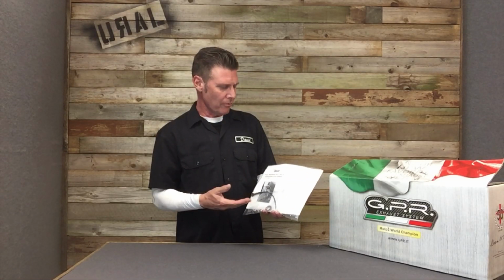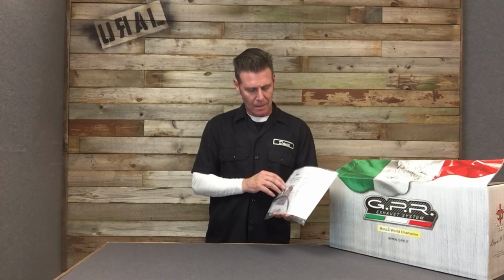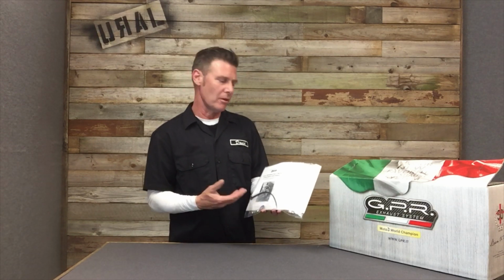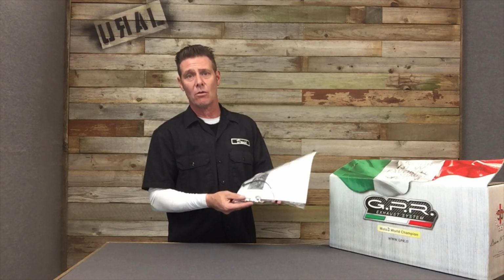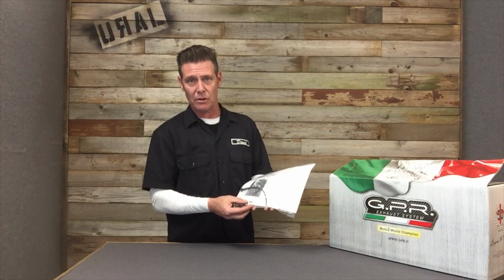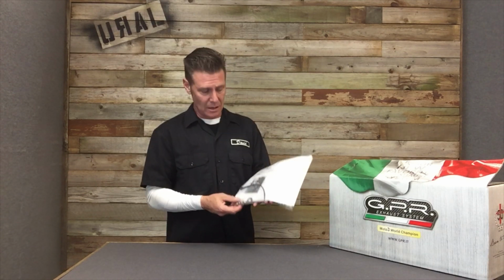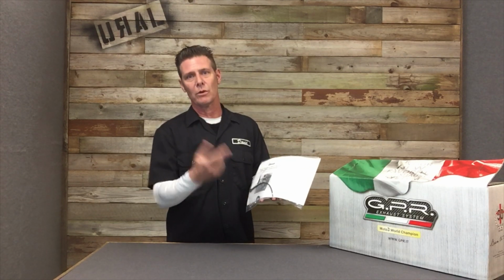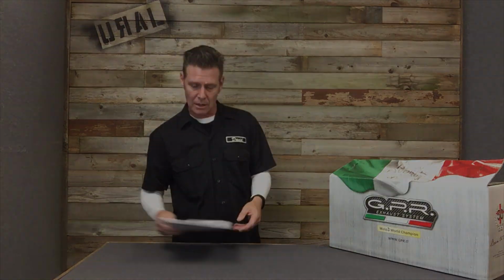What's included in the bag that we provide is a PDF version of the instruction booklet. We took a few days to install it ourselves and included a few other items that we felt were necessary for the kit, including 4 new stainless steel acorn nuts for the header flanges, a stainless steel distance ring that goes on the rear foot peg on the left hand side, and a couple of zip ties for resecuring your harness to the bike when you're done.